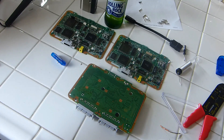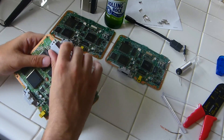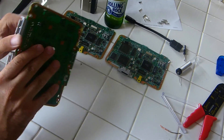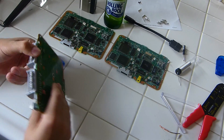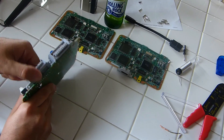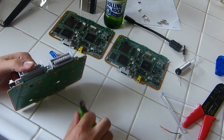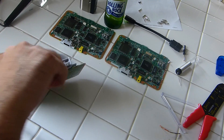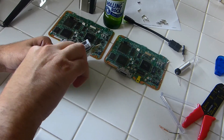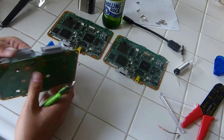I'm going to show a different way that I went about doing it this time. In the previous video I just removed the solder a little bit, but I found this way was a lot easier and gives a cleaner connection. I don't really care about the board, but I'm not trying to break it — I'm just bending it a little bit so I can get to those leads and snip them. I just want to snip those leads to get the controller ports off fairly cleanly without having to desolder all those connections.